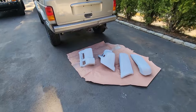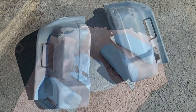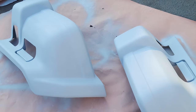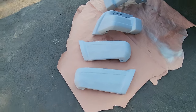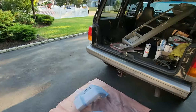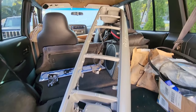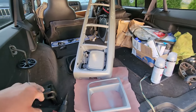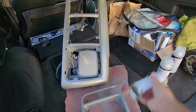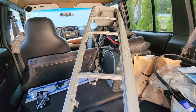I think the hardest part now is gonna be painting these bumper ends. They were in bad shape — sanded them down, used some Bondo, sanded more, used primer, sanded more, more primer, filling all the little holes. We've got a lot of gnats out here — they kept landing in my clear coat. When I resprayed the header panel, the correct paint is PS5 Silverstone Metallic — not PS2 bright silver, that's WJ color. This is XJ color. It came out awesome, look at it — it's beautiful.